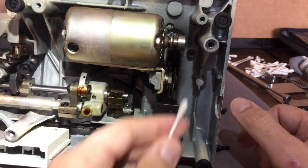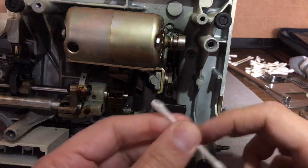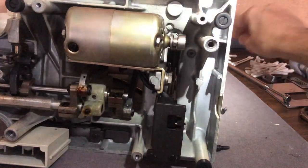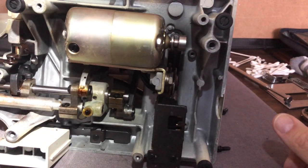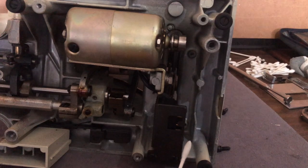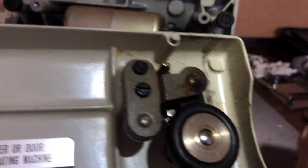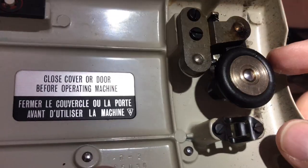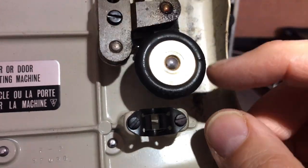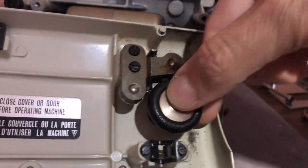Some of what's coming off is actually just the breakdown of the old belt. Plastics are not inert materials — rubber compounds degrade over time. Also worth mentioning: this is the bobbin winder tire, which by the seventies sits underneath the lid of the machine. As I turn it, you can see there's at least one crack — probably more. It has dry-rotted as well. Would it still work? Possibly, but this is not expensive to replace.